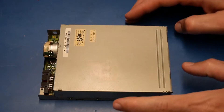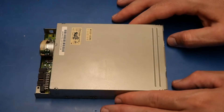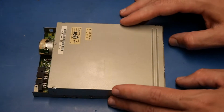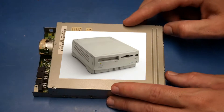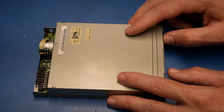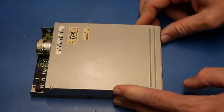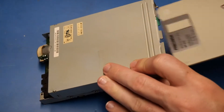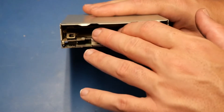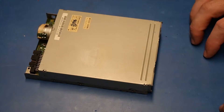Hey guys, K2's Retro Workshop here. Today we're going to be doing a simple rebuild of this MF355F floppy drive. This is the Macintosh floppy drive out of my Performa 630 CD — the small desktop form factor. This same model of floppy drive is also used in the PowerPC pre-G3 era of Macintosh machines. This guy has a problem with taking discs in, it's not smooth on ejecting, and because it was built without a cover over the front, we end up with dust getting in there, the head kind of sticks, and it just needs opened up and rebuilt.